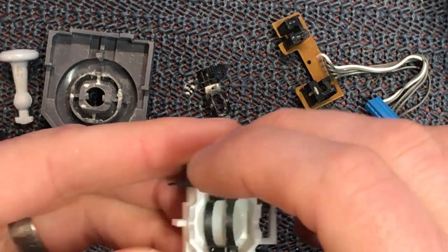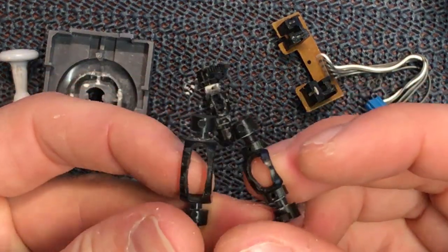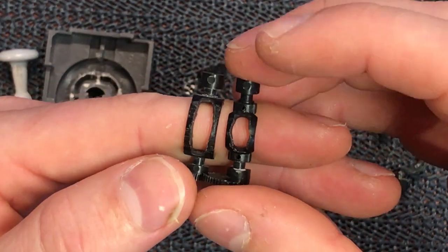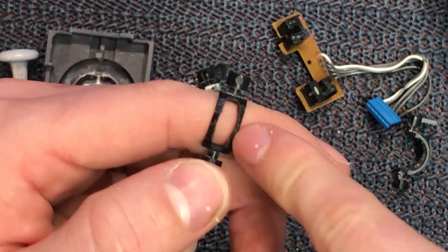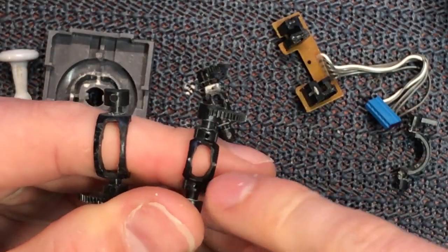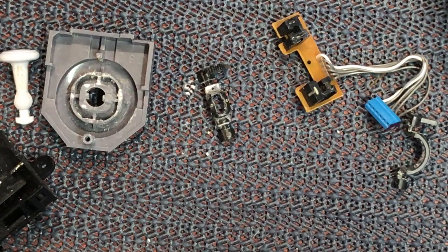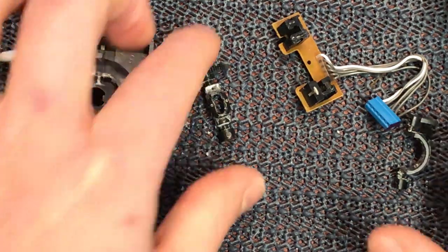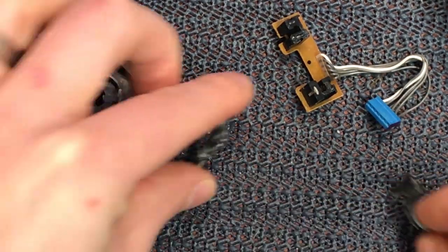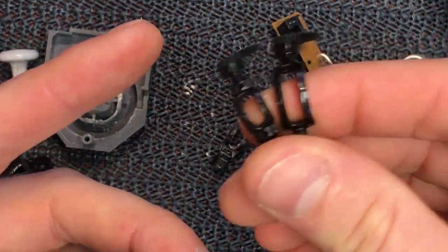That wear gives it the sloppy, loose feel. I've got two other joystick parts from a different controller to show you what actually goes wrong. These two gears have very obvious wear — they're not straight anymore, not parallel, the edge is completely worn down. This one is also completely rounded off and not straight. That really adds to the sloppiness of the stick. Going back to our parts, they're not too bad visually but they are worn, and this bowl has really taken a beating.